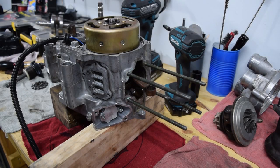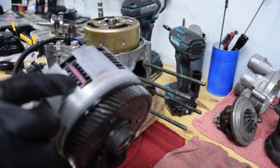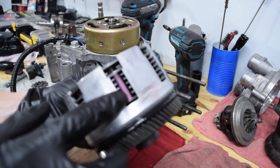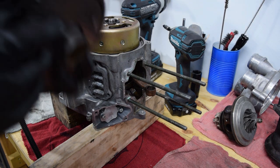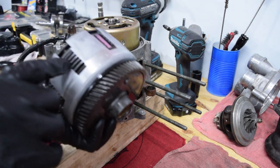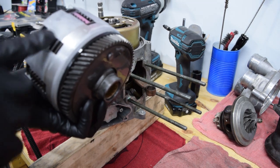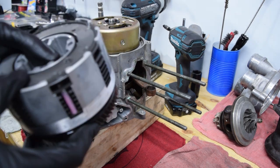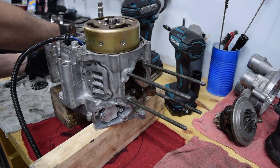Okay, so I figured I'm not going to film every part of this, but I wanted to give you an update as to where we're at currently. I went ahead and took apart the clutch assembly. I haven't taken each piece apart, just because I didn't want to risk losing anything. This looks a lot more complicated than the blaster setup. But I'm figuring some of the clutch friction plates are stuck to the metal plates, and I think that's going to loosen up in time, so I'm not going to mess with this. I didn't find anything else really surprising.